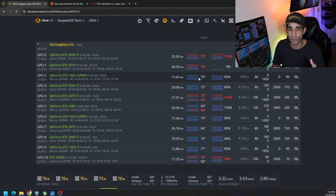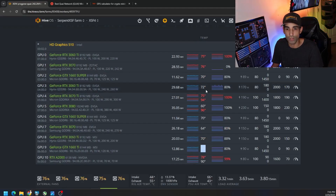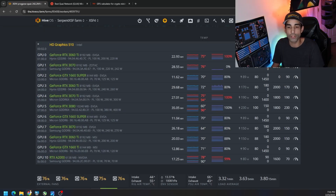The 1660 Supers are sitting right now at 70, 70, and 71 degrees — previously they were at 74, 73, and 75, so again three to four degrees average drop. The 3060 Ti from MSI and another EVGA card also dropped — on average we saw 76-77 on the MSI card and 74 on the EVGA 3060, now down to 72 and about 72-73 respectively. That's two degrees on one and four to five degrees on the MSI version. So on average across all GPUs we applied Duronaut to, we dropped about two to three degrees.